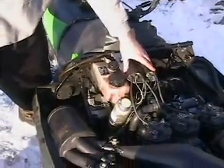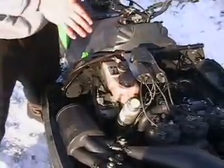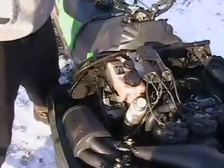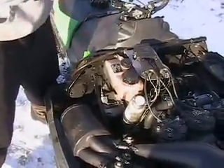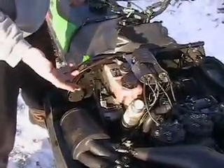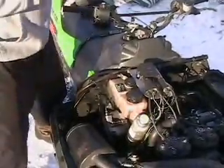So now you've either got a stator problem, a trigger or pulsar coil that's gone dead, coils that have gone dead, or possibly a CDI box that's gone dead. Check all wires everywhere — I can't stress enough the grounds. Some guys find a wire that was wearing on a cylinder, had shorted and grounded. Coils: swap out with a good set if you can to check them. Stator: follow my stator checking procedures in my other videos. Pulsar coil: check my pulsar coil test video — just check it for resistance. Be aware that pulsar coils, stators, and even plug caps can all ohm out okay but still be bad.